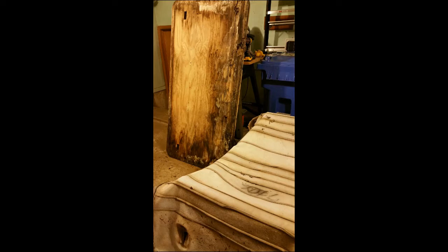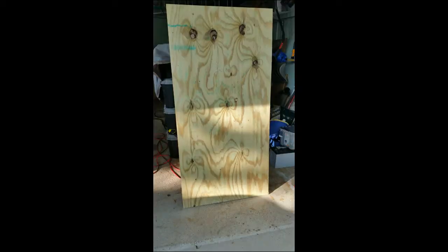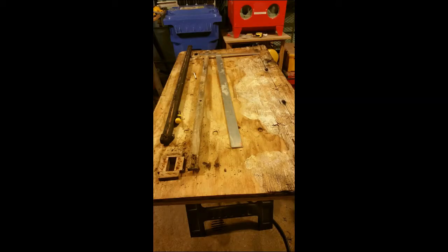Now I've got the rotted wood from the engine hatch separated from the cover, and off to the side is a thick foam pad that I've set aside to reuse. I've got them apart and now I need to recreate the parts. I've got a new piece of plywood to use as the basis of the new hatch, and the old rotted piece I'll use as a template to get the outline of the corners and rotted areas — usually you can interpolate between the edges that remain.